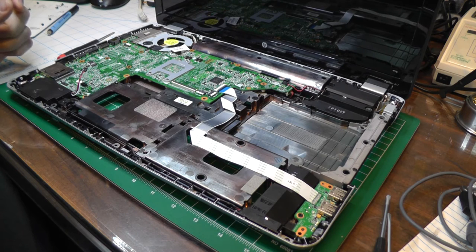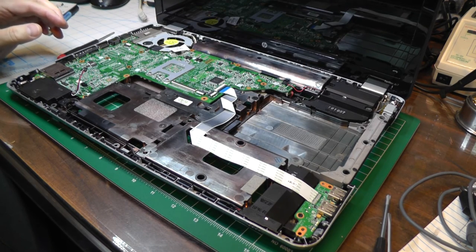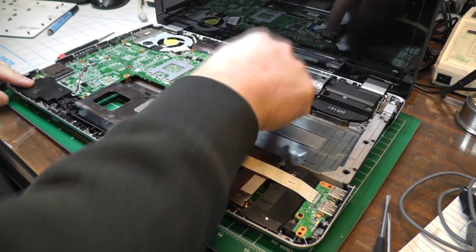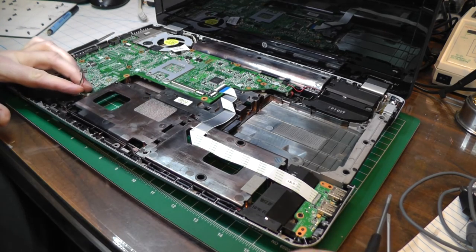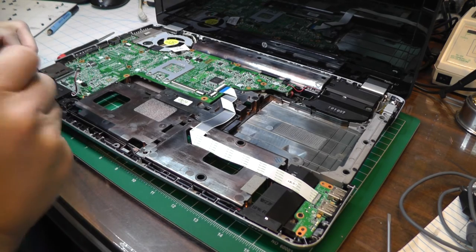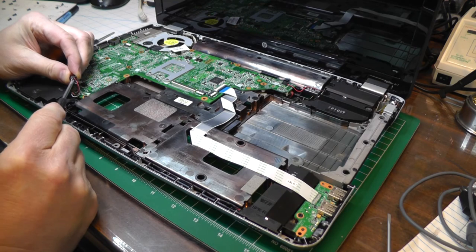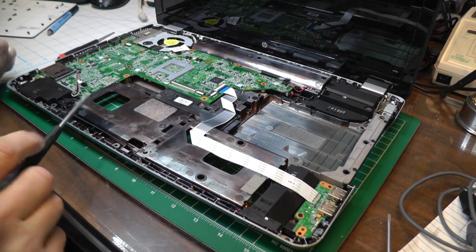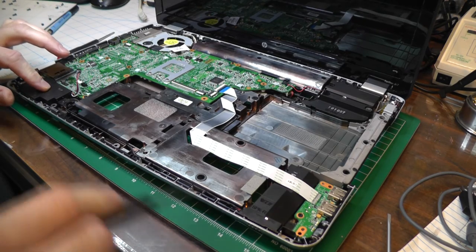It's back apart again, partially. Everything works really great — Windows 10 installed, updates are good — but the one thing that doesn't work is these front speakers. The rear sub works, which we connected here, but the front ones don't. I noticed this cable here is all hosed up — it looks like when they went to pull it out of the connector they wedged something in there and it's all broken. It might be shorted. So it's either just shorted and needs fixed, or something burned up with the speakers. I have the old base with a good wire and a good speaker set, so I'm going to pull this out and see what needs to be done.